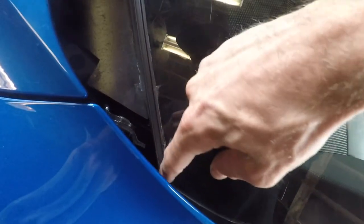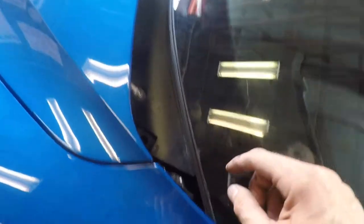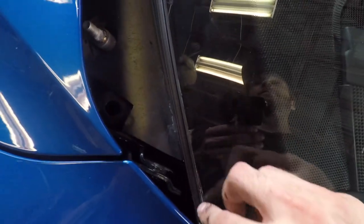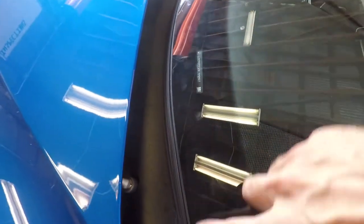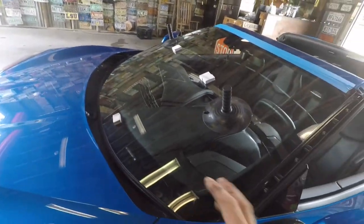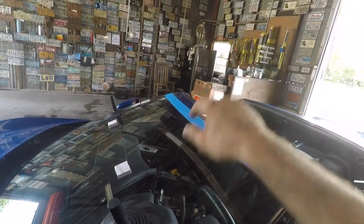The next step is to start putting everything we took off back on. On these types of moldings there's an insert in them to keep the channel straight and prevent chipping. I've got to get that out — I usually use a small hook tool to get the corner started, or slide it out so some is hanging and just grab and pull it. Get that out, put the rain sensor back on.